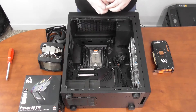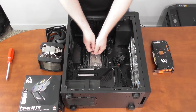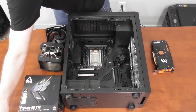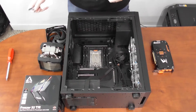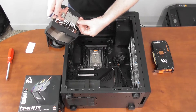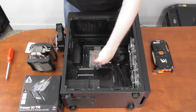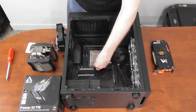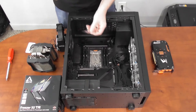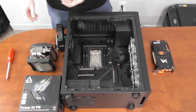We're going to use MX4. They sent a little balloon of MX4 but we'll use our syringe so we can get a nice clean line. If you want a guide on how big of a spot to make this, the plastic gives you an idea of how much coverage there will be. If we stick the plastic over here you can see it's not quite going to cover the whole CPU, so we need to get it from here to here — just a few dots, which should be more than enough to fill in all the little gaps.